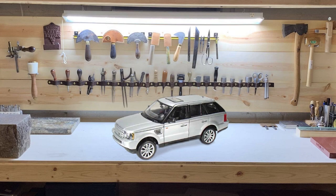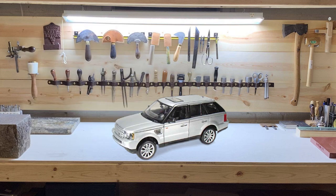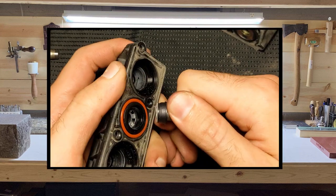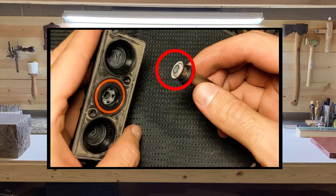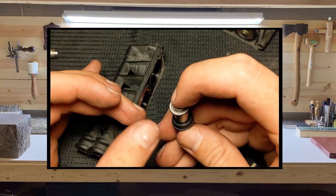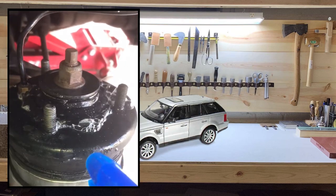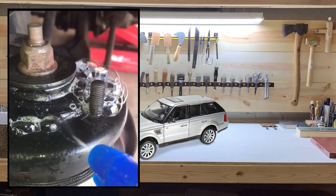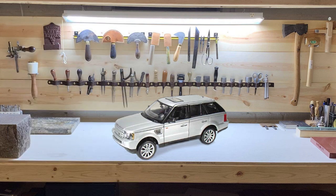So that's how the air springs fill and drop normally. One issue is that the air compressor uses a chamber full of desiccation beads to dry incoming air before it's compressed. The beads tend to create dust as they age, and the dust deposits on all surfaces inside the air suspension system. As the dust settles, it interferes with the rubber seals of the solenoids. Additionally, it's not uncommon for the air springs themselves to leak, given that they consist of degradable rubber, although this is more prevalent in the full-size Range Rover.